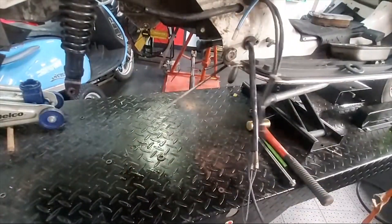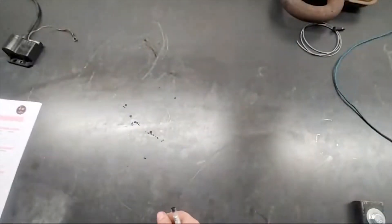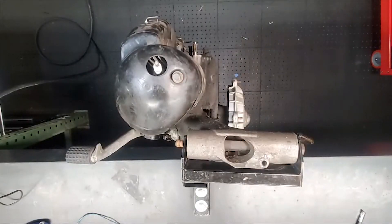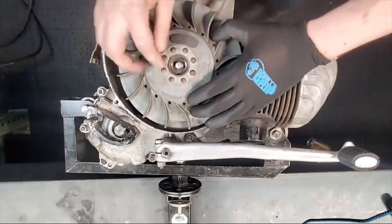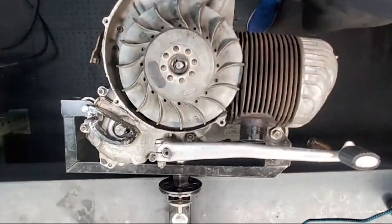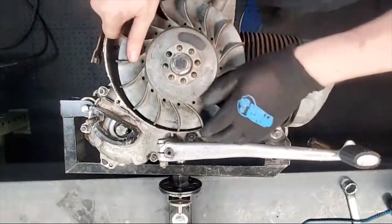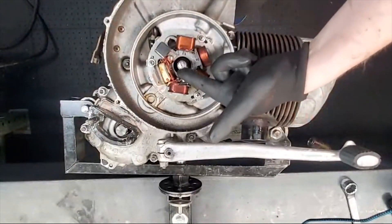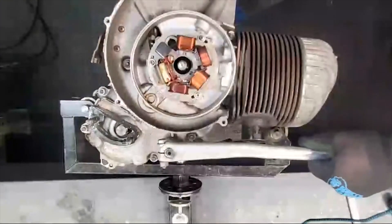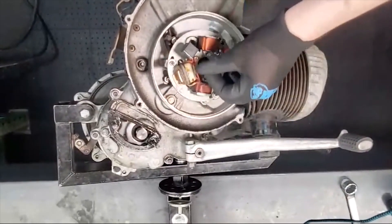Every time I tear down an engine, be it for myself or for a customer, I use a five-page checklist to make sure that some parts are reusable or are required to be replaced. The motor itself actually fired up, but the way that the flywheel was bolted down onto this crankshaft was really sketchy. That's why we decided to remove everything, do a full analysis, and see what's happening. Here you can very well see that the thread on the crankshaft has been basically cut off and there wasn't enough thread to keep the flywheel on.